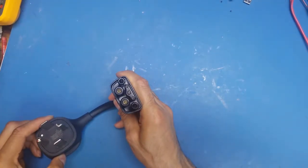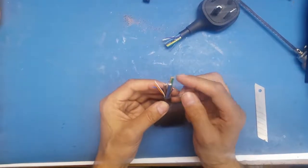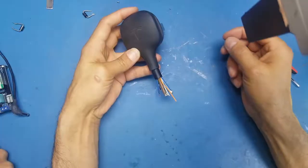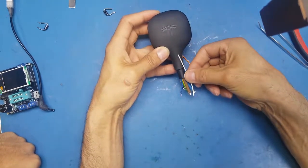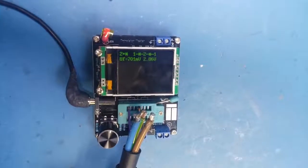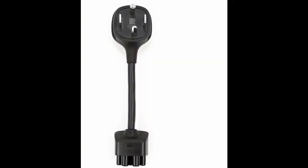My plan was to cut open the adapter and solder the extension cord in between the two ends, but I found that there were small wires inside that appeared to carry a signal from each end of the adapter. After noticing that two out of the four wires were unused, I pulled them out and connected the remaining ones to a component tester. The reading indicated the signal came from a two-way diode, but was most likely a confirmation chip that appeared to have the same response to the input signal. I figured the chip must be in the plug, as that ensured that nobody could modify or tamper with the plug — but not me.